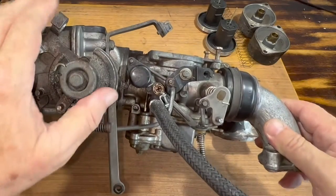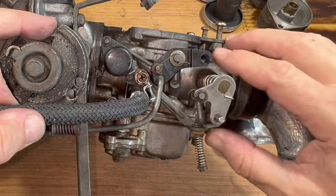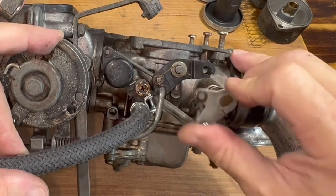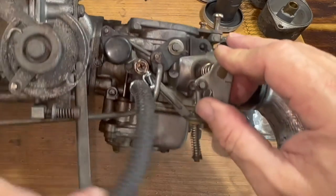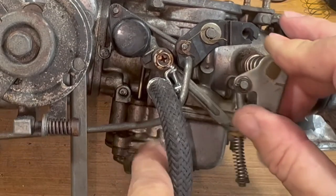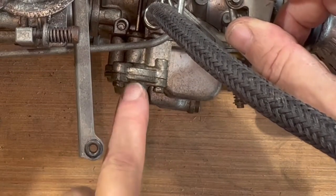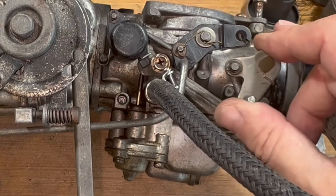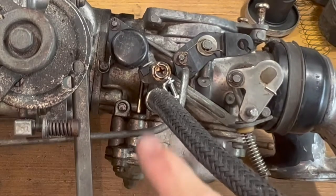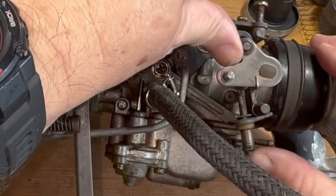I think I've got to take this hose off. This is an accelerator pump. You can see it moving this rod right here, going down into the bowl. This one has a little pump housing — it's like a little diaphragm pump. So you hit throttle, boom, it goes up and pumps some fuel into that cylinder. It stops there and you can see this spring just collapses.